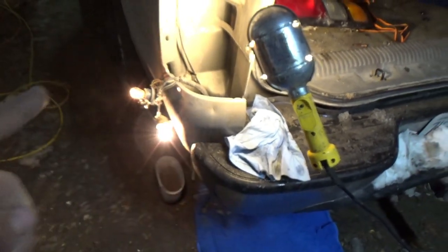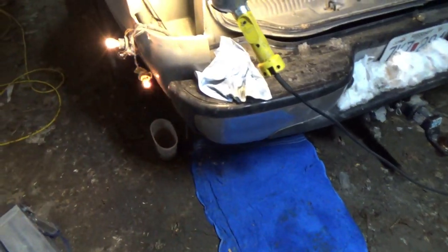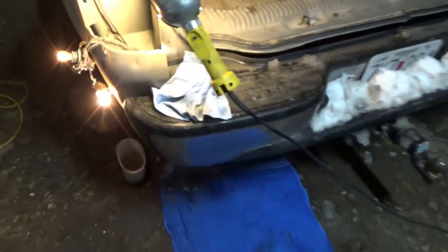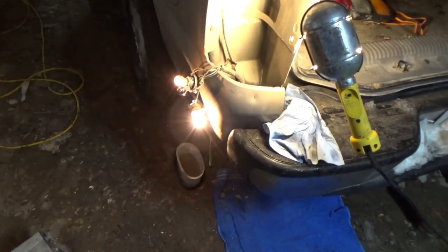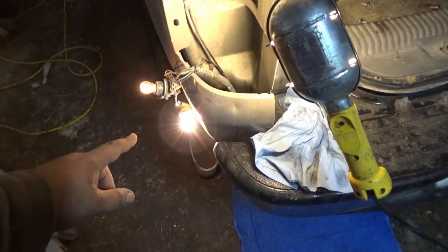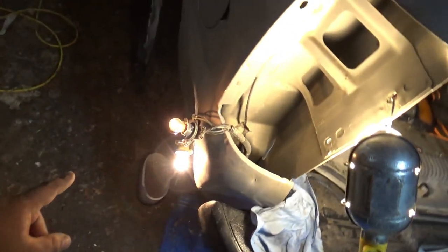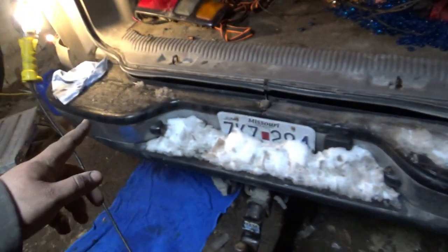It's fixed! We got under there just directly underneath. All I had to do was clean mine up — it got dirty and corroded. You can see some dirty water there. I spread some carb cleaner on it to dry it off, then used contact cleaner for electrical. We have a tail light now and we have a turn signal now.